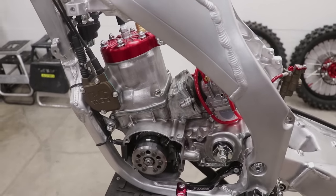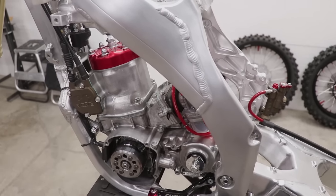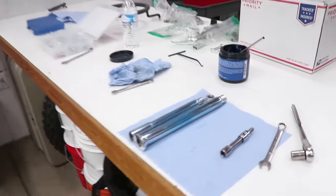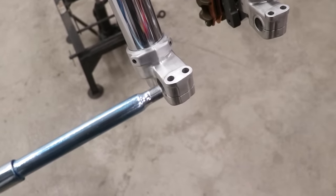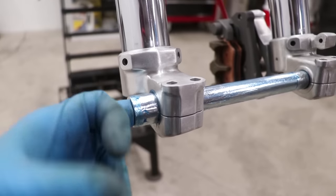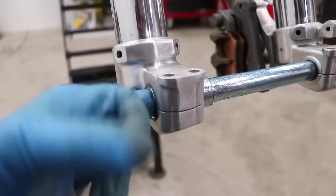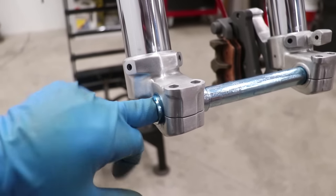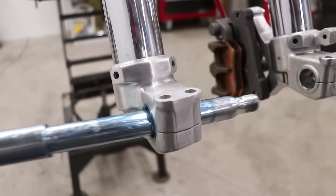If you're going to be leaving a lot of these bolts loose until you get your bike together, make sure you make a note of that — you definitely don't want to be out on the track and have your shock fall off. Let's get this front wheel bolted up. Before I do that, I'd like to check the axle in the lugs to make sure it's not catching up on anything — I'm just going to slide this through. We definitely want to make sure nothing is catching up on the right side; this is the side that aligns the forks. If you have any hesitation there it's going to be tough to properly align your forks. Slides really smoothly thanks to the zinc plating and grease.